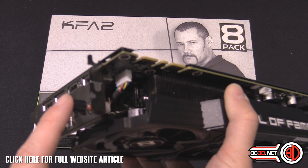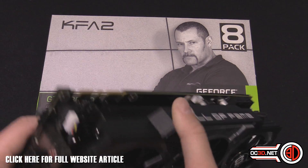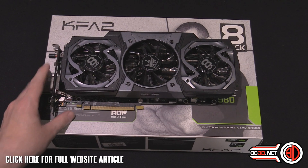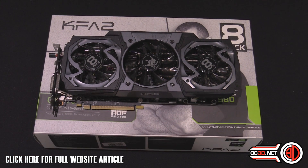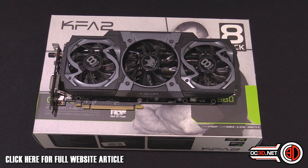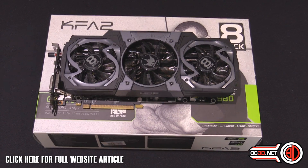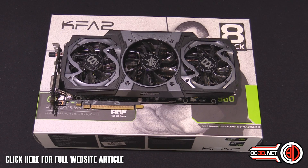This really isn't something you want to have pressed and running all the time, but for those bursts when you're going to be benching or something like that, this is going to be perfect. They spent a lot of time and money on this, trying to make sure this is the best 980 you could possibly get your hands on. Things like multi-layer ceramic capacitors, eight-phase GPU power, two-phase memory power. There are DR MOS IR3555 next-gen components with a 60 amp output, and aerospace-grade power inductors. Honestly, the spec list is like a dream spec list.